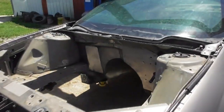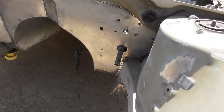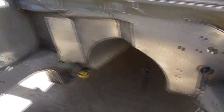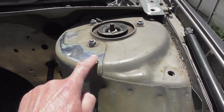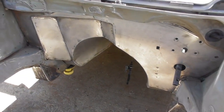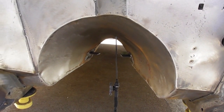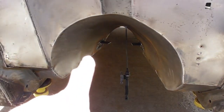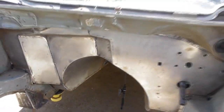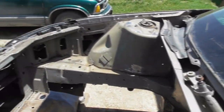Okay, I got the hood off. The reason why I pulled the engine out was to finish up the firewall — do some grinding on the stuff. There's goofy studs that are stuck up there. I'm getting ready to give it a paint job. You can see the tunnel and the mounts for the cross members back in there. I'm going to give it some black paint, make it look a little better.